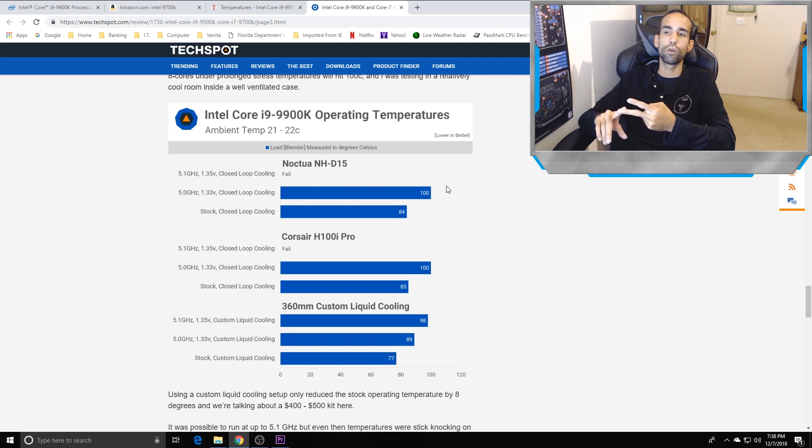Check out Buildzoid at Actually Hardcore Overclocking — I'll link his channel in the description — he'll give you a list of good Z390 boards. With good cooling and a board like the Aorus Master, set it and forget it: voltages will be fine, you'll still hit 5 GHz single-core and 4.7 GHz all-core, and temperatures will be in check. For the enthusiast overclocker, this cooler can handle it just fine for short durations, but I would not recommend running 5 GHz all-core 24/7/365 with the H100i V2.